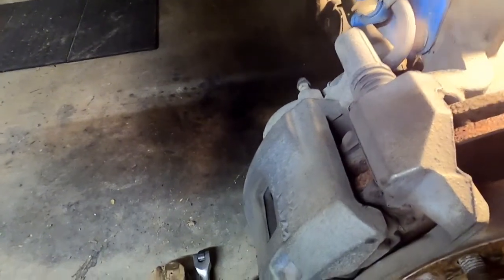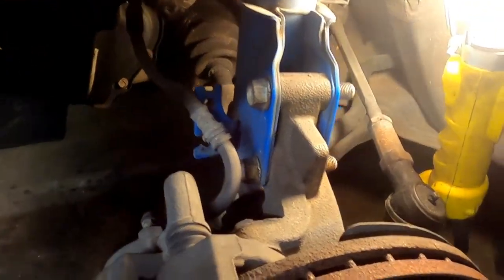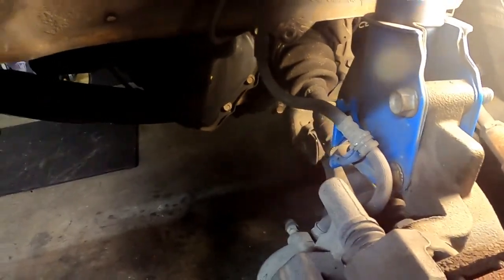We'll do a quick recap right now, then we'll go over it once we're done. Gonna finish pulling the ball joint out from underneath the spindle. Gonna take that clip off the brake line up there. We're gonna do everything we can to remove the outer tie rod out of the spindle itself. We're gonna drain the gear oil, and we're gonna pull the spindle and the CV axle out of the trans. I've got a couple wires, and instead of disconnecting all this, I'm gonna hang the spindle off the strut and wrap the end of that axle in a rag so it doesn't get damaged or dirty.